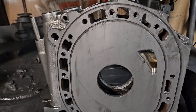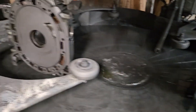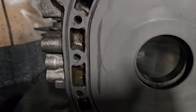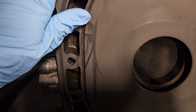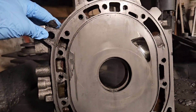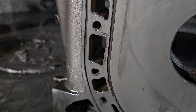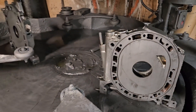We're going to throw these on the lapping table and take a look at them in a day or so to see how they're going — flatten these back out, make them look as good as we can, almost like new. And here you can see some of that wear and corrosion fully exposed after a light hit on the lapping table. Some of that wear is really deep, and some of that corrosion could have really led to premature failure or definitely a lack of metal-to-metal contact in that water jacket and main water seal area. These were perfect candidates for lapping and bringing a set of housings back to proper spec.